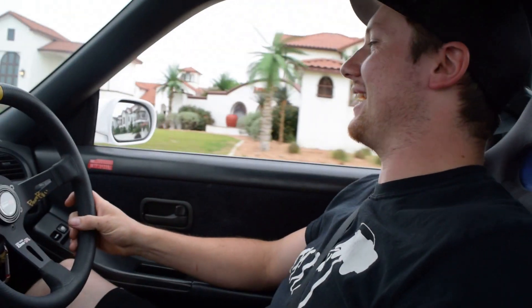So we tuned it last night on a lot of full throttle stuff because we want to go fast. Then tell them what happened, Kev, this morning. So he goes to drive it again this morning and it basically did not want to start, run, or idle. So we're going to have to work on that — we didn't do any corrections. This thing is running no coolant temp corrections, no IAT. It's because it was rushed, so don't hate massively.